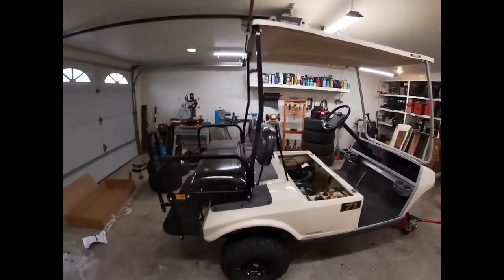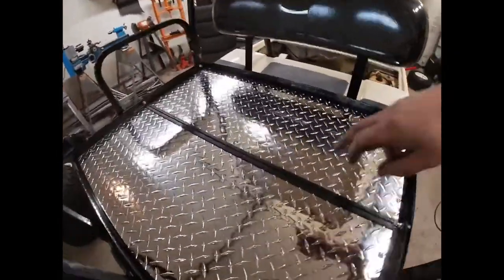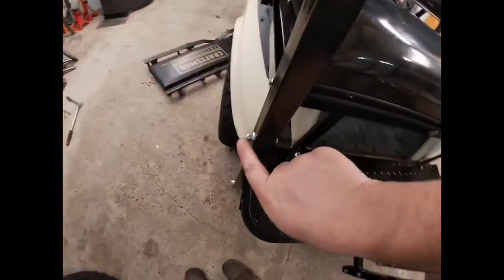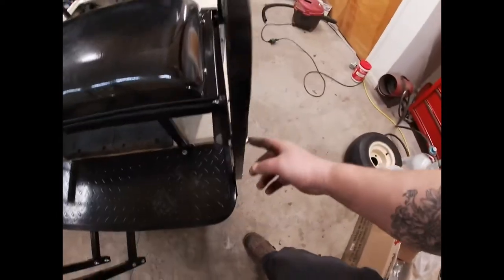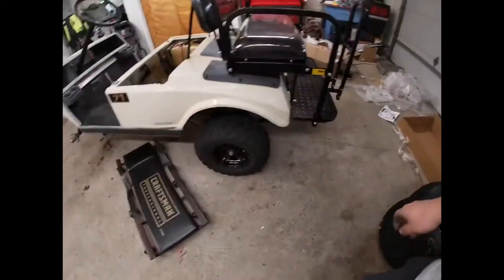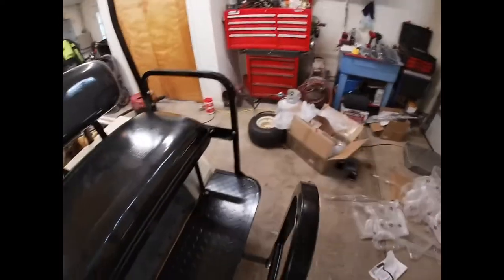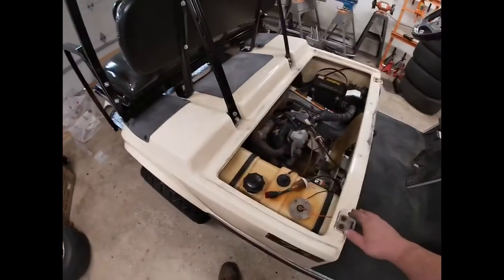We got the back seat put on — it went pretty easily. Some of the self-tapping screws they give you want to stop before they suck the seam in because the holes aren't drilled big enough, so you'll have to drill those out a little bit yourself. These bolts go through with no support, so don't reef on them — just snug them up. I figured out the brake cables too: there's a hanger a bit further up and you just have to retie the brake line somewhere else, no big deal.